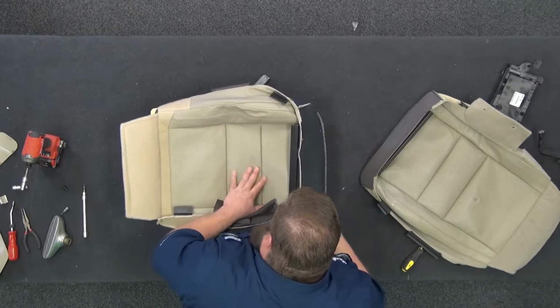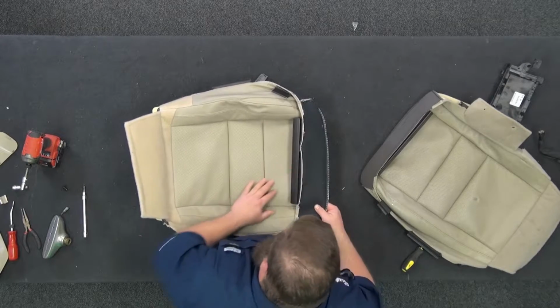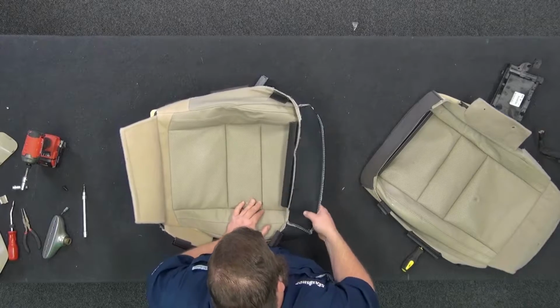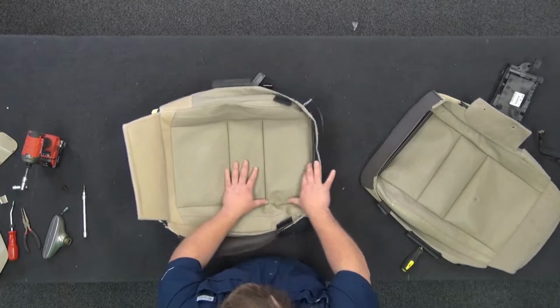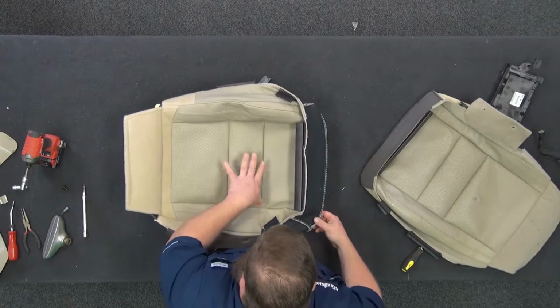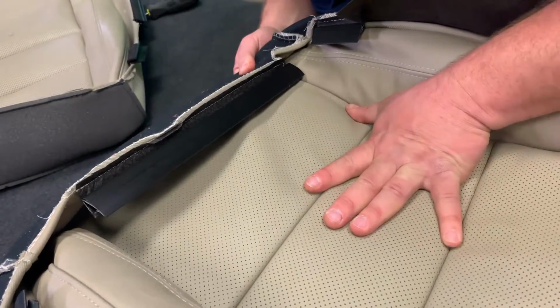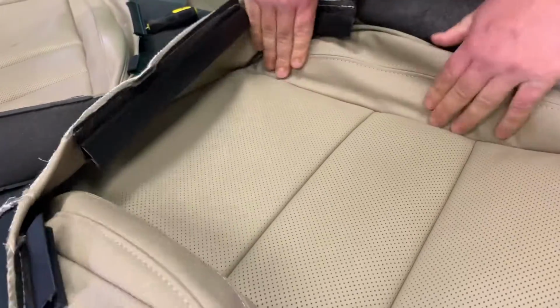When I have it stretched forward, then I'm going to take this thumb and start working it down that seam to attach it, okay? It's going to pull it tight. It's going to make sure of this, because if it's half-assed back here and hooked on, you're going to get all this gathering and puckering in there. You don't want that. So pull that up. We're already set from here to here. Hold thumb here. We're going to pull here. Pull tight, pulling forward, and then I'll work with thumb down that, attaching that seam, okay? So that seam is nice and tight there.